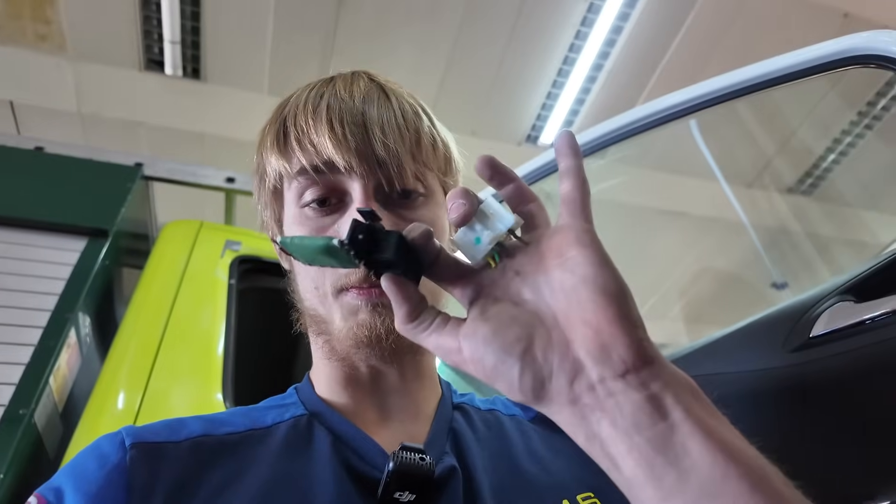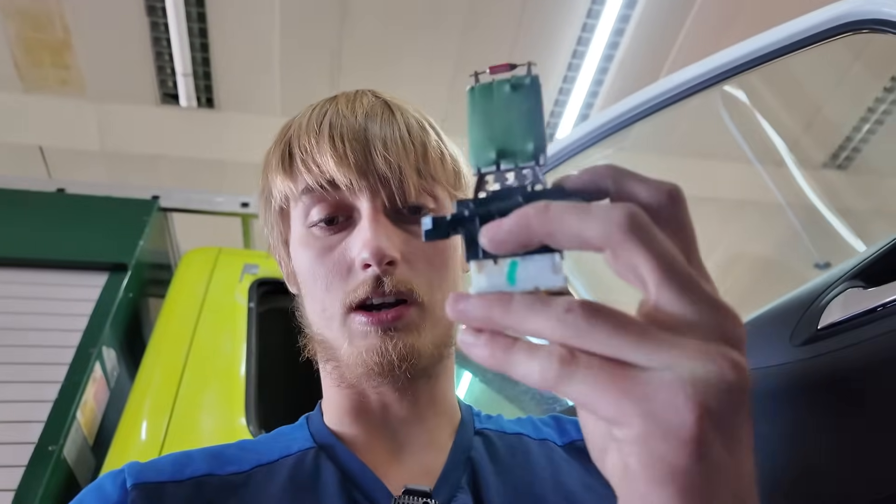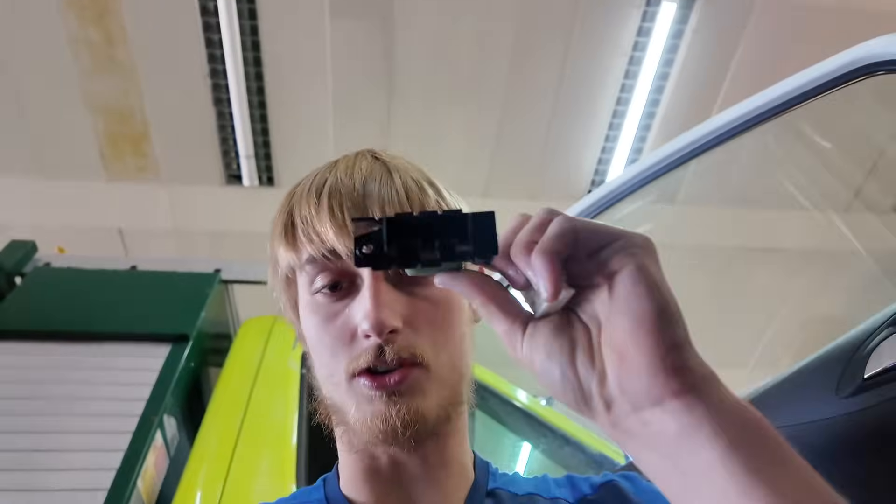What we need to do now is just make sure it is wired up properly. I'm going to grab the other plug and make sure all the new wires correspond to the correct pins on the old ones. We'll go to the yellow and green wire first on the car and make sure it's going into pin one on the new resistor. I've identified that pin numbers are marked inside the old plug.